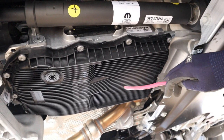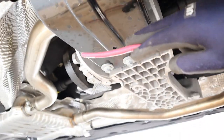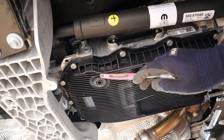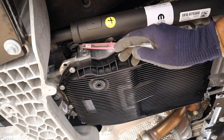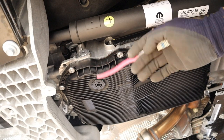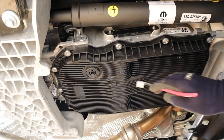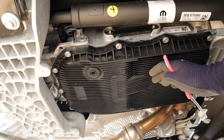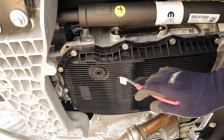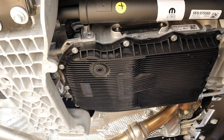Taking a look at the 8-speed automatic transmission, it's located underneath the vehicle situated longitudinally — it first powers the rear wheels before sending power through the transfer case to the front wheels. Servicing the transmission fluid is not too difficult — there's a drain plug and a fill plug; you pull out the fill plug at operating temperature to allow excess fluid to come out, and there is no dipstick. What I find interesting is that this transmission pan has fins on it but is made of plastic, which means it won't really aid with cooling. One downside is that the pan incorporates the transmission filter, so when you have to change the filter you're also changing the pan — that's probably going to be costly.